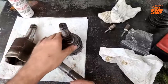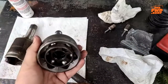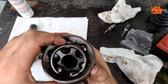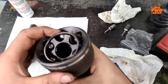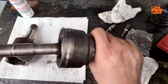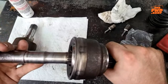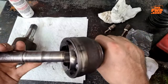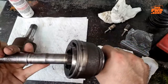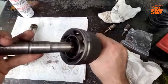Now, how come, Todd, if I go into the corner and crank the wheel as hard left as it'll go, and then I stand on the gas and it bites, I break stuff? Well, that's because you are probably something like this, where you are on the outer edge of the cup and your cage and all of that. So the harder you turn, you've got to remember, if you've got a lot of camber like I do, this is going back in with about 10 degrees of camber. Going in, it's going to be at that angle or so. That's nothing. However, this combined with this is. So if I've got full cranked left, that's where I'm at. So I've got the compound angle of camber and turning. That's the problem.